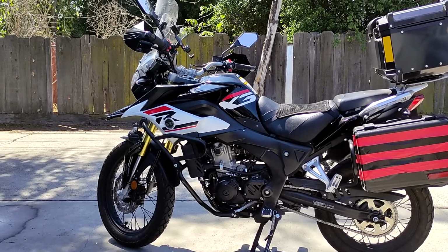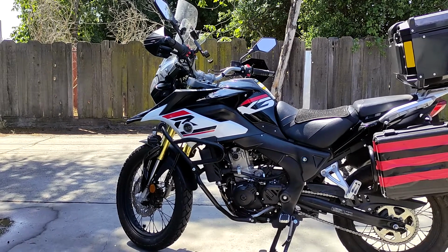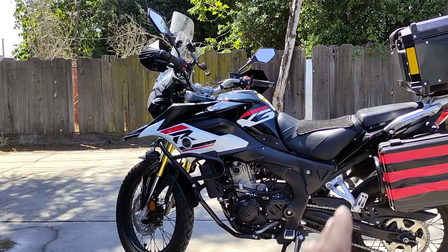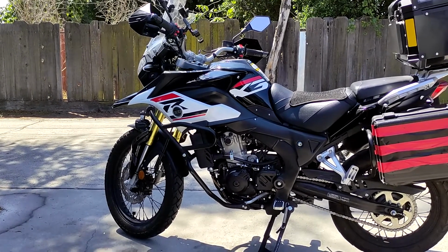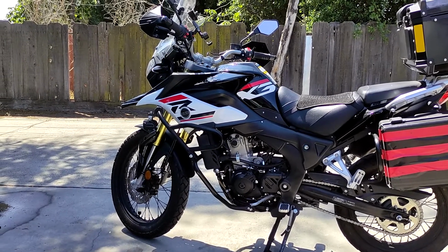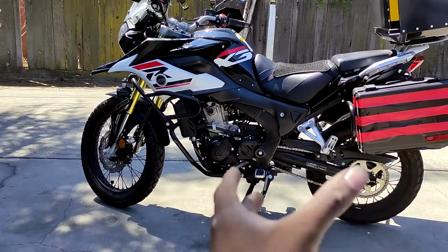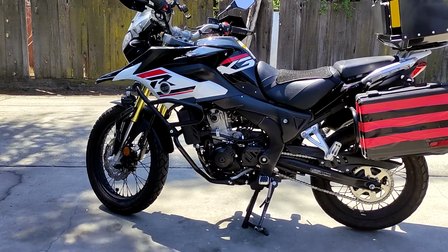On this bike, I almost doubled that mileage up to 1644. And the reason being is because every time that I adjusted the valves on the new engine, it's always been at the much larger spec, closer to 0.08. I actually use a 0.076 millimeter shim. That's because that's just the closest thing that I have to the 0.08. I lost my old feeler gauge somewhere. I don't know where it went. So with those type of results, the riding has been the same. The rider has been the same.